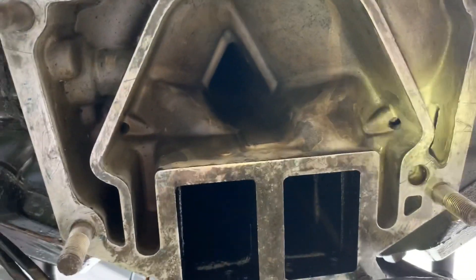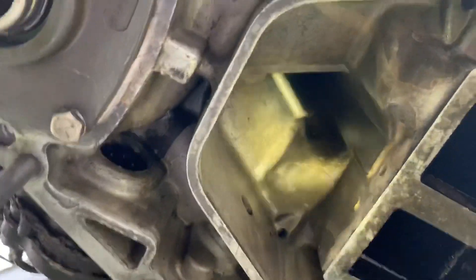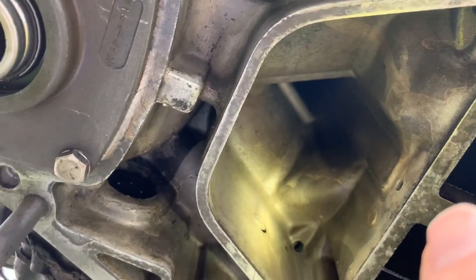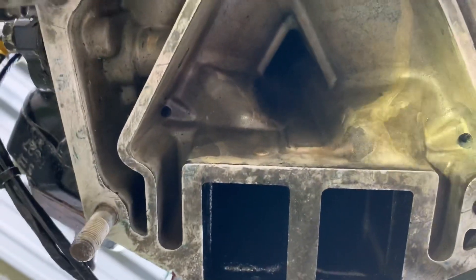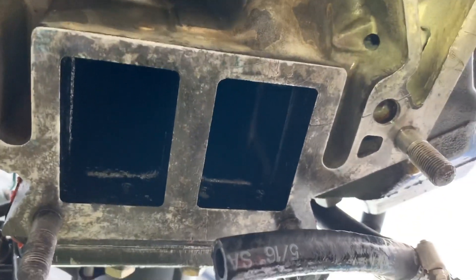This is the main water chamber. It has channels to the exhaust, and then it has another opening on this side which goes straight to the poppet or pressure relief valve, which relieves pressure through the exhaust.